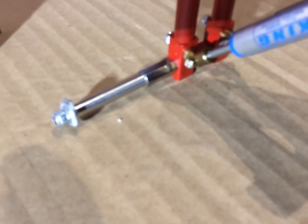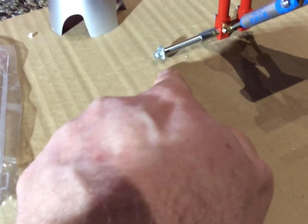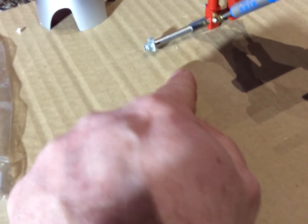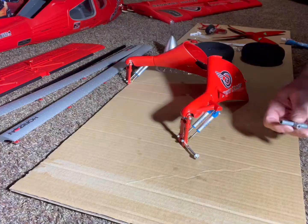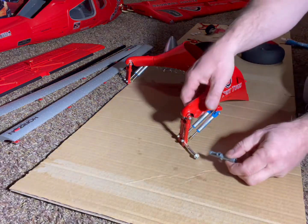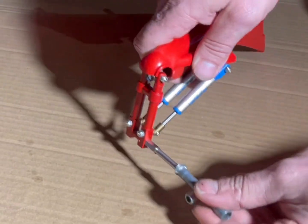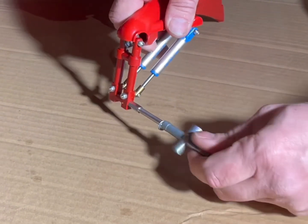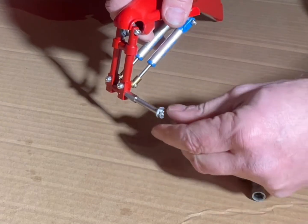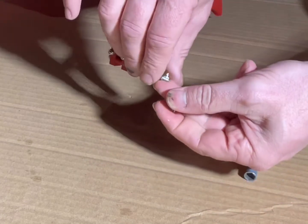First thing we're going to do is take off that little nut there on both sides, and there'll be 3 washers. We're going to push 2 washers back to here, and the last washer, then we'll put the tire on, and then we'll put on the small washer. So this is the wrench that we'll be using here. It's 5.5 millimeter, and just taking off this here. The first washer we'll take off, and then the other 2 washers we're going to leave on.